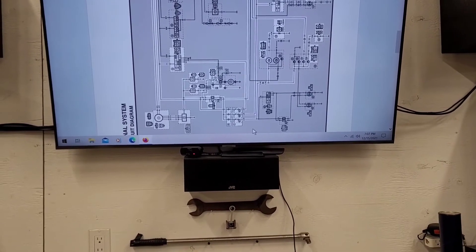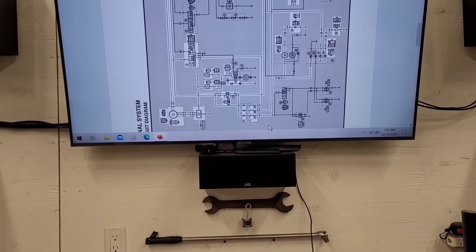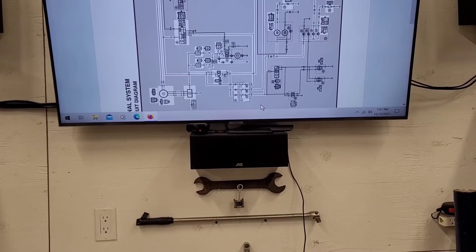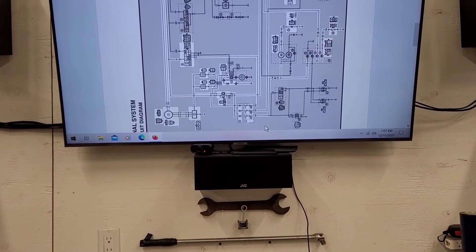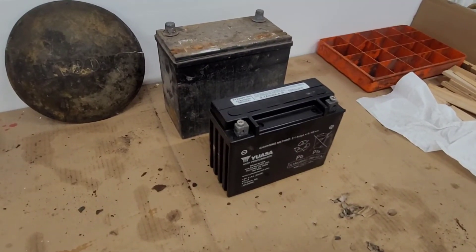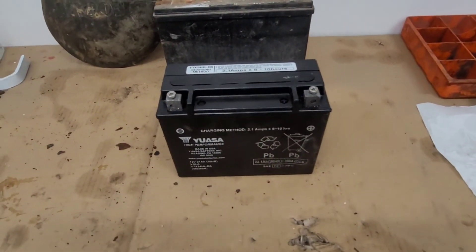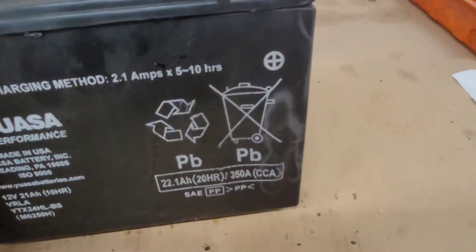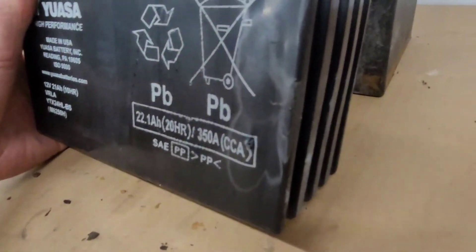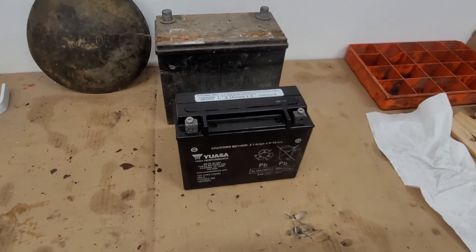Here's the diagram — I've got it loaded up on my screen and was lucky that Google was able to help me out. Looking at what I know and what I've done in the past, it's not looking good for the stator at this point. I'm thinking that's where I'm going to start — get some readings off of the stator and then move towards the coils. Unfortunately the charging trick did not work; the voltage did not go up at all. Upon further inspection, look at the damage — it's got a nice big bubble and there's actually a hole right there. I think it may have frozen. So this battery is no good anymore — into the recycle it goes.